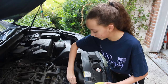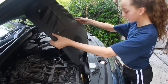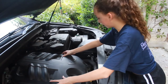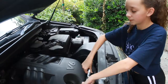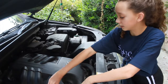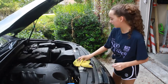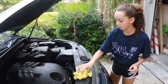You can see that it's full because it's right at that full line. Now it's time to put everything back. You can put the plastic engine cover back like so, then take your bolts and start screwing them in. As you did with the oil filter cap, you can tighten these to 10 foot pounds too. Now you can clean up any excess oil that may have dripped so you don't leave any messes.